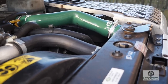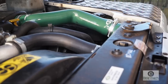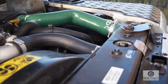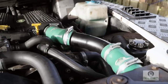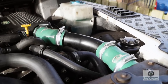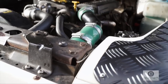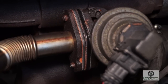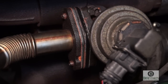This flexi pipe, if you happen to be replacing the top hose, actually flexes quite a lot and will expand when you accelerate and boost — this wastes just a little bit of energy that would be better pushing air into the cylinders. You could adapt the pipe, cut off the EGR part, and use a solid piece in the centre. This we've done because we did have a problem trying to get the bolts out, so we've blanked the plate off here and the EGR valve is not leaking.